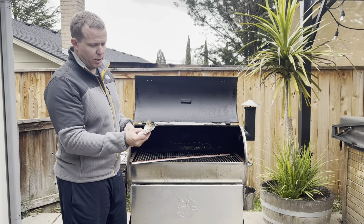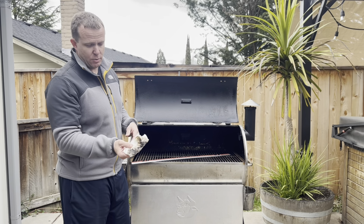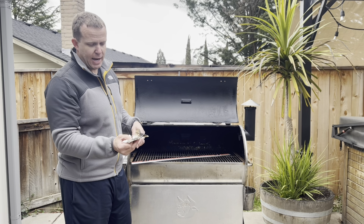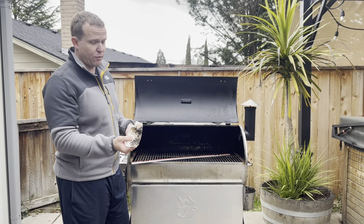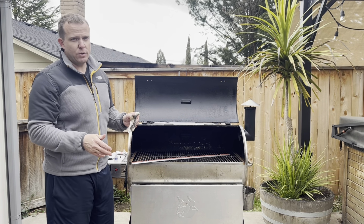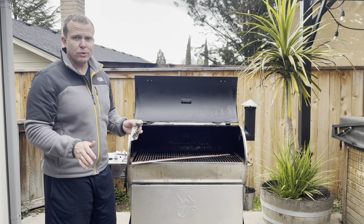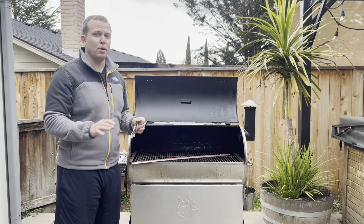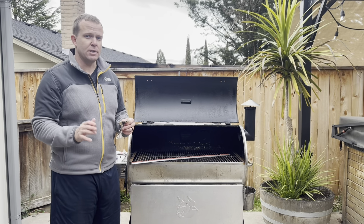This is just a simple tub of hand degreaser wipes. You can see we try to keep a pretty clean smoker, but even with that, preparing our surface for the RTV, a quick wipe with that, you can see it does have quite a bit of residue on there. Getting as much of that off as possible is going to give you the absolute best adhesion with the RTV. Don't worry about getting it back to a factory new shine. You're not looking for absolute perfection in the cleanliness. The RTV will cure over time and seal that up nice and neat.